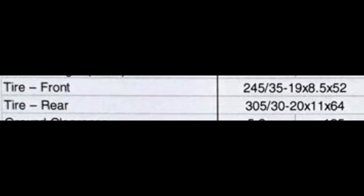One of the other bits of information I thought was interesting is the tire size. The front tire is going to be a 245-35-19 and the rear is going to be a 305-30-20. That doesn't seem to account for any differences in the Z51 package. With the C7, the Z51 actually changed the wheel sizes — 18s front and 19s rear for the base, 19s front and 20s rear for Z51. With the C8, it looks like you get the same size regardless. The front wheel is 8.5 inches wide and the rear is 11 inches wide, which should leave decent aftermarket options.